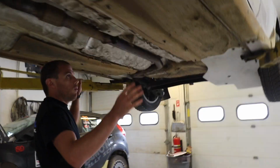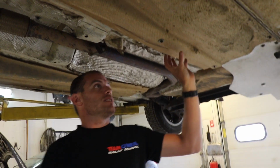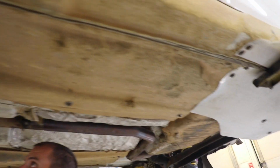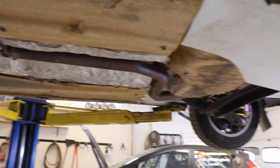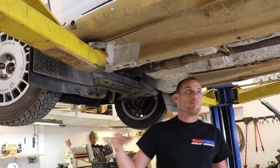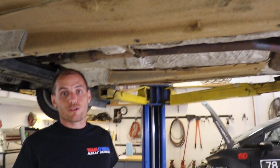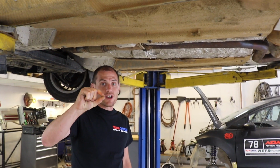Moving down the car, what we do here, and again, for a racing car would be highly recommended, these are Kevlar underbody protection pieces. So with a front wheel drive car or a 4-wheel drive car, it's actually shocking. That gravel spray that comes off of the front tires is like the worst sandblaster you can imagine. So having good, rugged, strong mud flaps will help deflect those rocks down, but even so, having all of those rocks pounding the bottom of your car will literally wear holes in your floor. Your floor just starts getting thinner and thinner until there's no floor left in your car.